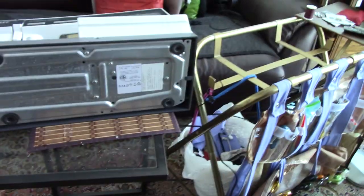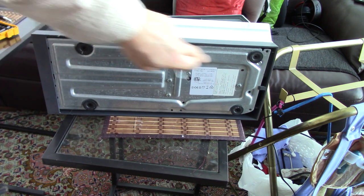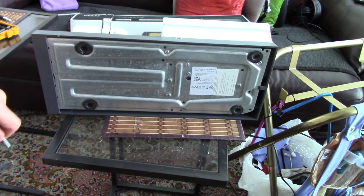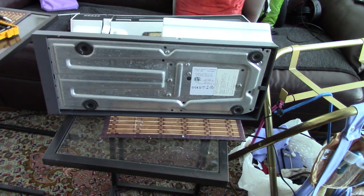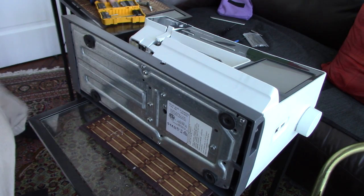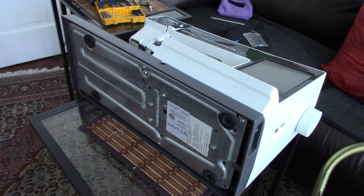So the bottom of these machines is a bit of a minefield of, well, which ones do I loosen? And this took me a bit to figure out the answer to that. But the secret is that one, that one, that one, and that one, I think. The rest hold the machine part, all the mechanism, the frame and everything else to the base. And in fact this one is built in Sweden. I just noticed that on the bottom. So where they built the Husqvarna Viking, they built this one.